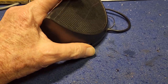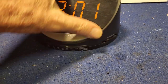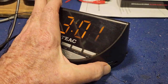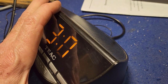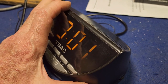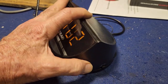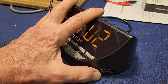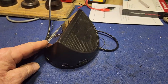There's our volume on that side, so our volume is flat out. It's on FM. That's our tuning, and I think our radio's on - yes, it's on. So if we tune it... I don't know if you can hear that. It's not even static, it's just a bit of a crackle. I'm going right through the full range of the tuning from one end to the other, and there's no sign of any stations. There's no hiss that you normally get on FM. If we go to AM, we have exactly the same. That strobe's probably driving you crazy. So there's an issue with the radio.